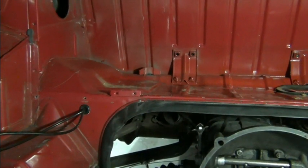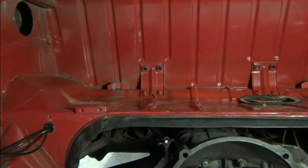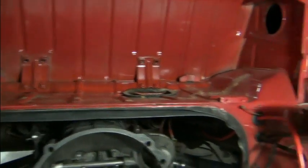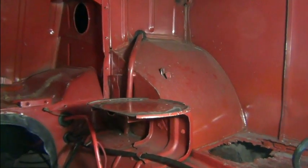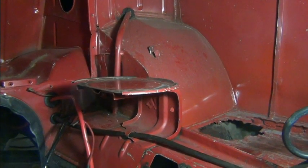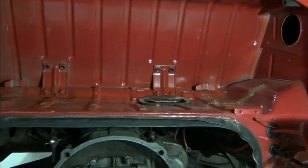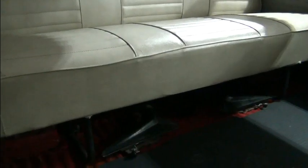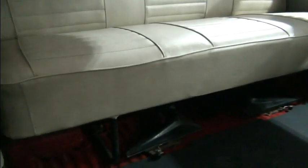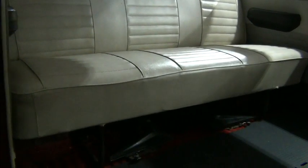It's a very similar setup to what we do on the Bugs and the Things. Instead of the electronics being behind the dash like on the Bugs, or in a junction box under the bonnet like on the Thing in recent videos, everything goes and sits right here on this pedestal with the main disconnect on there as well. There'll be a battery box in this area right here and then one underneath the seat, so one battery box under the seat and one in the fuel tank area. Back to work.